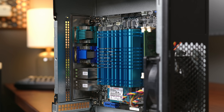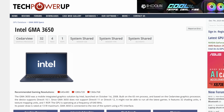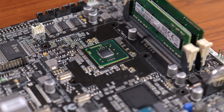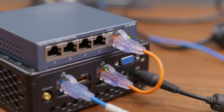But that's not to say we still can't find some ways to put it to use. I didn't even try it out as a desktop system because there's not even an audio output, the Intel GMA3650 graphics are not great, and the CPU performance just probably wasn't going to be up to stuff anyway. So I figured I'd try to play into what seemed to be the strengths of the system. Any time I see multiple NICs, my brain always jumps to building a DIY firewall — and with this, you absolutely could.